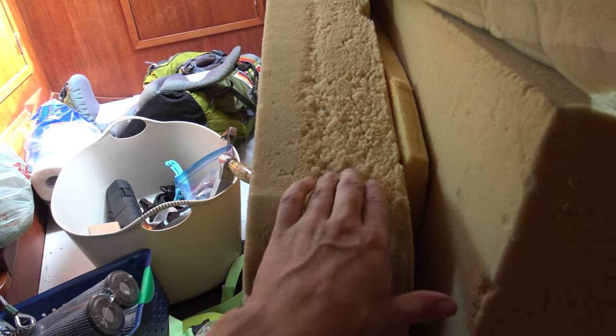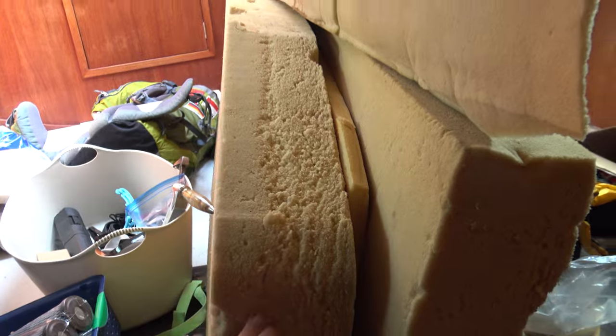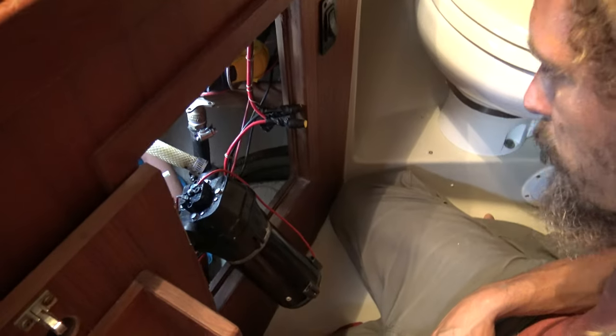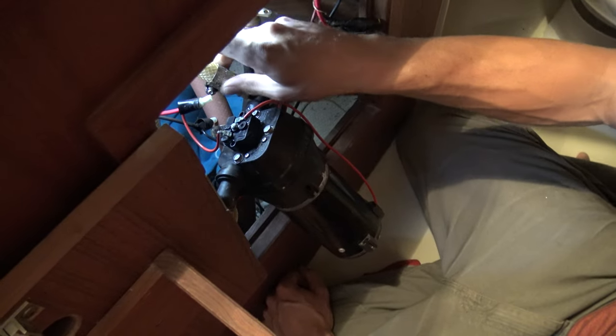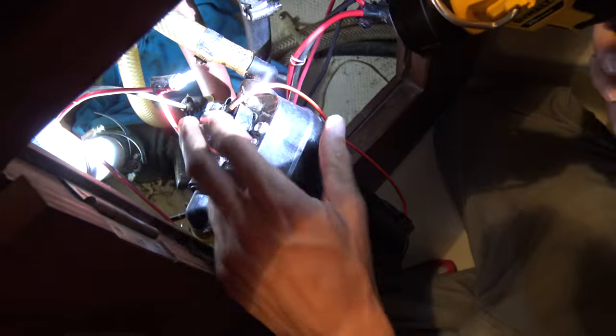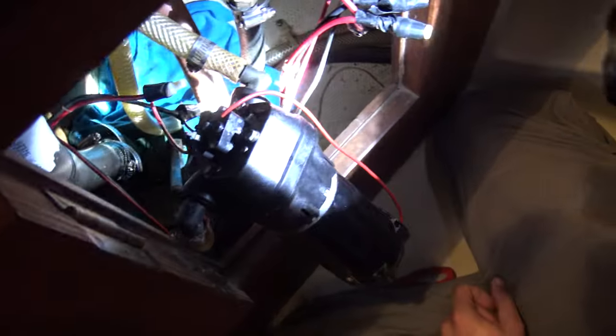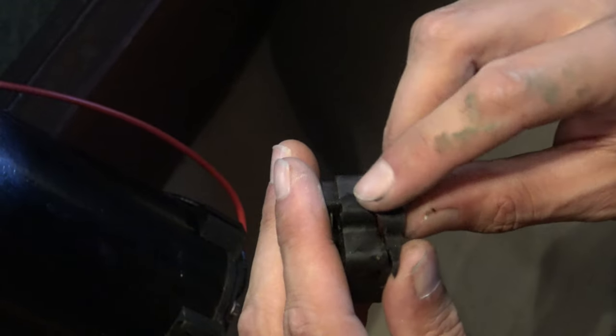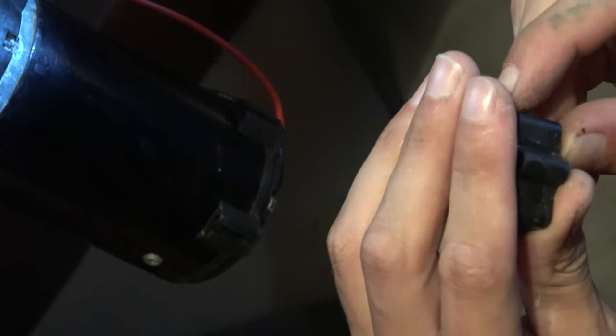This mattress is falling apart — we're going to have to research what we want to replace it with. But it does have these amazing huge storage compartments, even if they're a little filthy. I see the problem: the little pressure switch here is supposed to turn the pump on and off when the outlet has enough pressure, and it looks like the whole housing is cracked. The pump itself is still good, so I just need to find this part. We actually got lucky — it's just the little pressure sensor. We could even try gluing it together since it's all in one piece. The superglue worked for now, though I don't think it's a long-term fix.